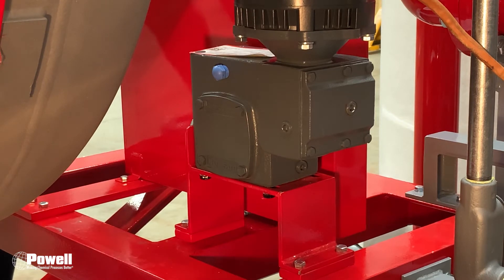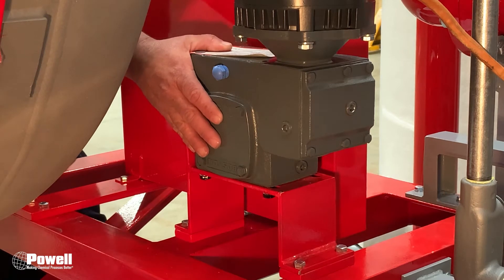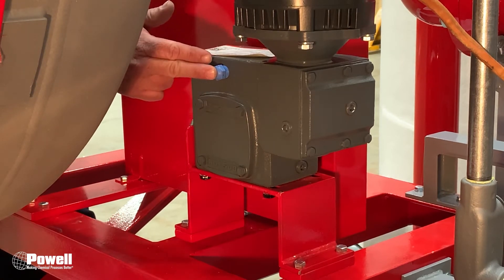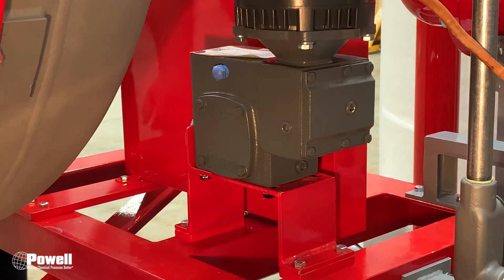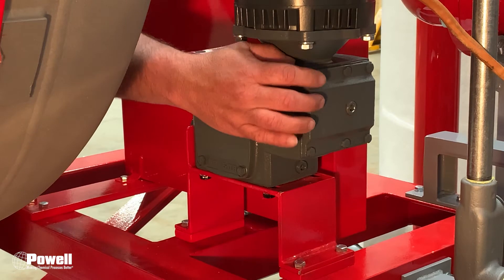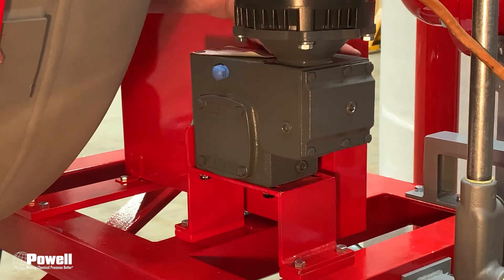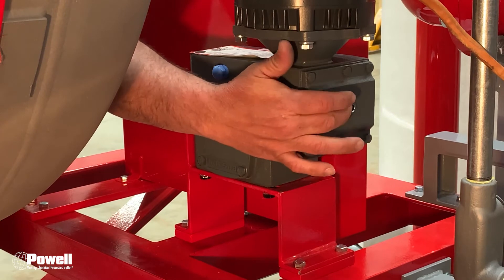What you're going to do is start by removing the uppermost plug out of the lower chamber unit — this happens to be the one right here with the blue vent cap in it. Next, remove the middle plug of the upper chamber, which is here. Do not confuse it with this plug, and there's also another plug higher up on the opposite side. Be sure you're removing this plug right here.